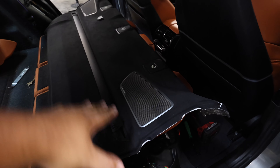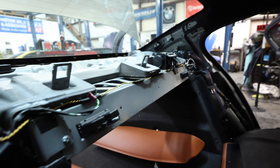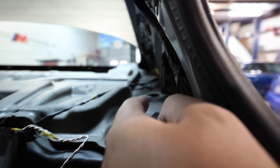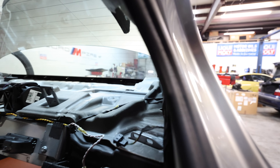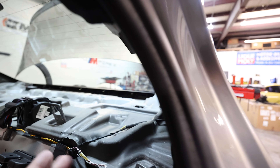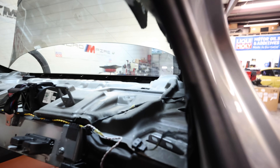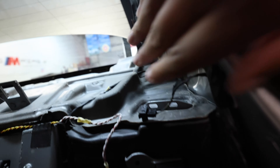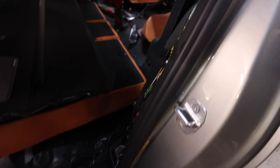So you can see this is the top rear section here that he just removed. And then you can see up here — you'll need access to all of that so you can get to the top of the seatbelt. Something else you do have to do is remove the seatbelts. It's hooked in by E-Torx right around here, so you will have to remove that as well. You remove all that so you can pull the foam back a little bit, and then you can get access to the top of the hat of the rear suspension, which is way back in the corner. A lot of work just to do some suspension work on the M5.